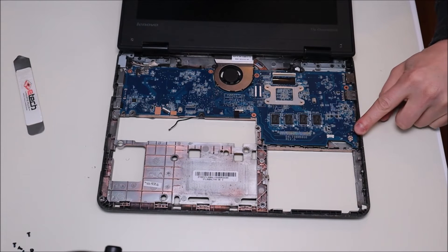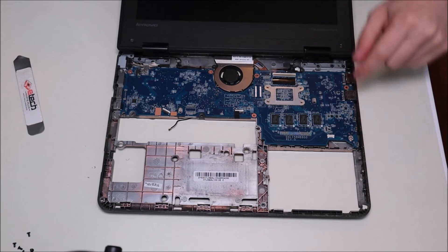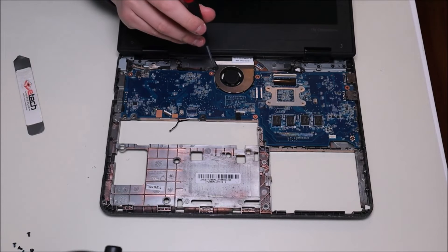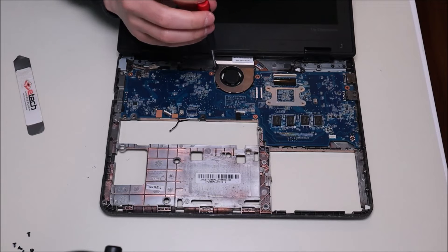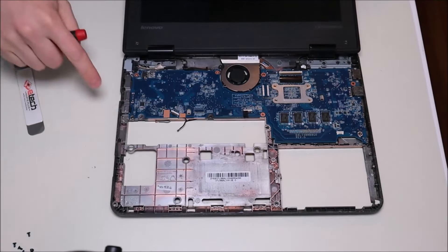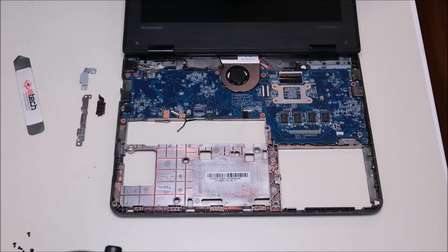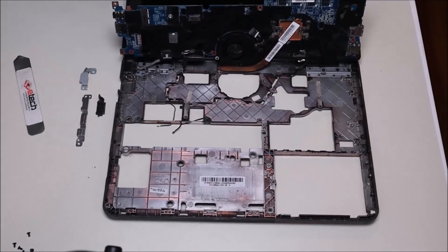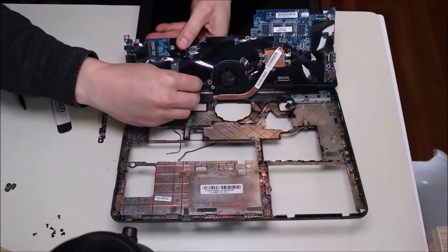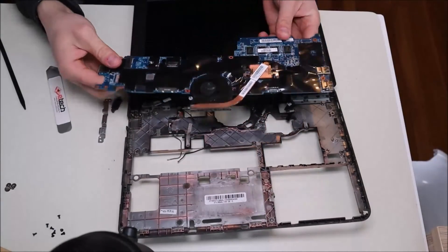To get the motherboard out, there's a screw here — you can see the little white triangle pointing toward the motherboard screw, which is a nice aid for reinstalling. There's another screw in the fan, which is attached to the motherboard, and one more screw over by your USB and power jack. Once those screws are removed that shield comes up. Lift up on the motherboard, pull on the relevant port, pull up the LCD cable, and the power button port unplugs by pulling out. Now we can set the motherboard aside.